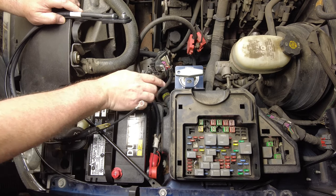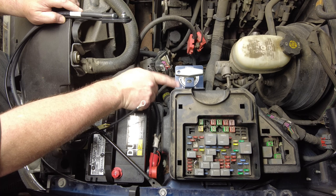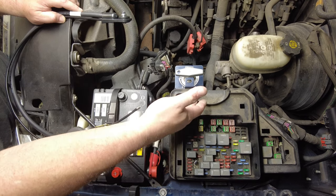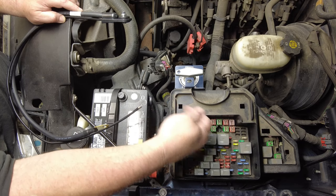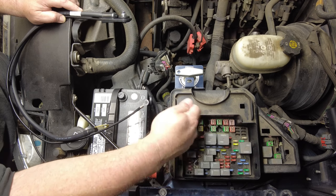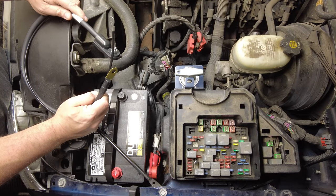Okay, and just to be clear, I wanted to make sure that those bolt heads on the inside of this mount were not interfering with any of the wiring. I didn't want anything to chafe back there. So I was able to snake my borescope camera down into one of these holes and make sure that none of these were rubbing against any of the wiring. So that's good there. And the battery cable that I'm going to use to do this, I ordered off Amazon.